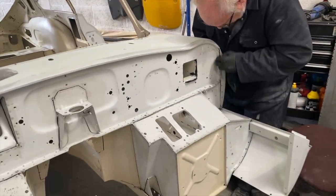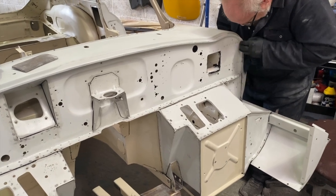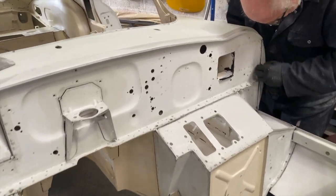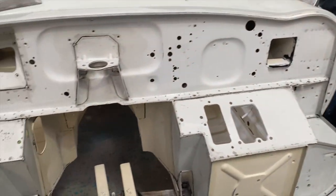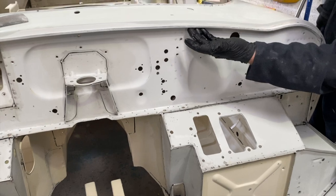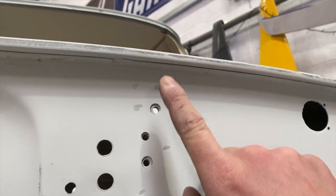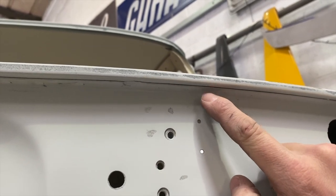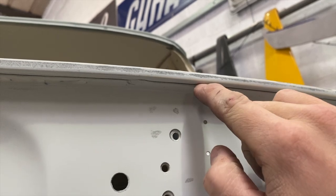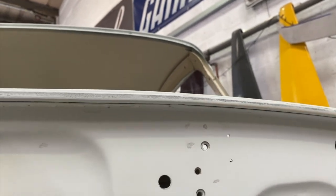AD's here, look, sealing the bulkhead up, down here, which is one of the last parts to do. Have you done all of them now? Are there any I haven't sealed? Up here. Oh, okay, yeah. So there's one up here that he hasn't done, and you can see what I'm talking about. There's this gap in between here. So when you paint this, you end up with that gap still being there. The water will get in, and then you'll get rusty stains coming through there.